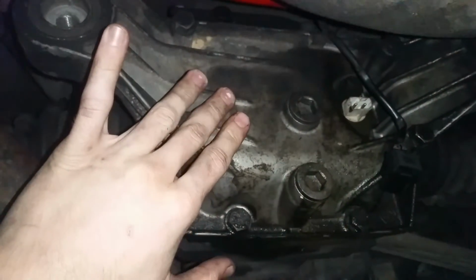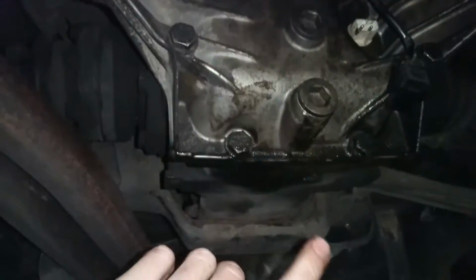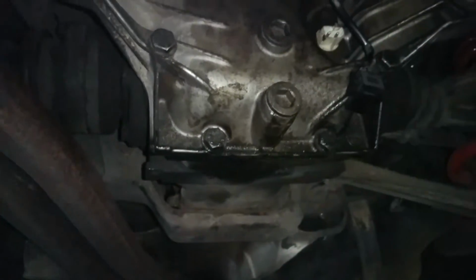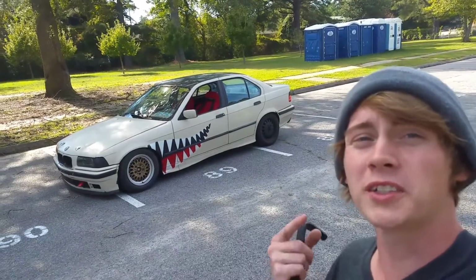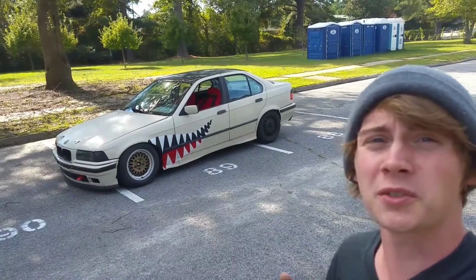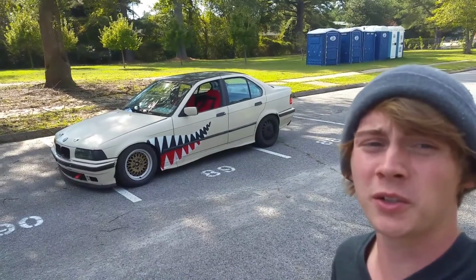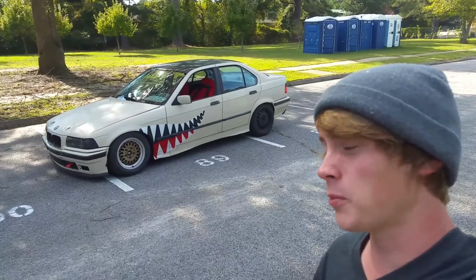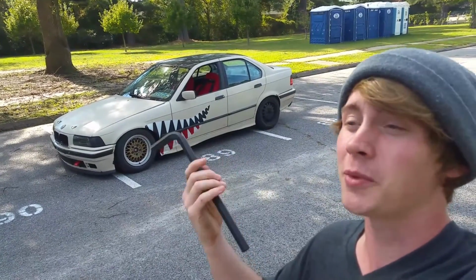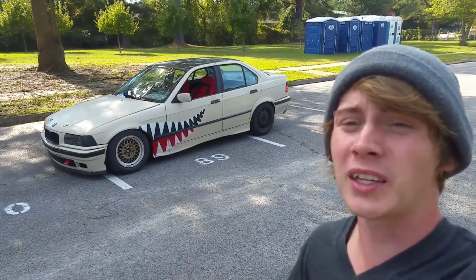Now most of the time they're on the rear cover, they're pretty easy to find, but sometimes they may be on the bottom. Then after you find those, you want to start by removing your fill plug. Now these plugs are typically 14mm Allens, which is a really large size. It's pretty uncommon, so if you don't have a socket, you can buy one, or you can go the route I did. I bought a huge Allen wrench off Amazon. It was prime, shipped in 2 days. It was like $8. I'll put a link in the description.